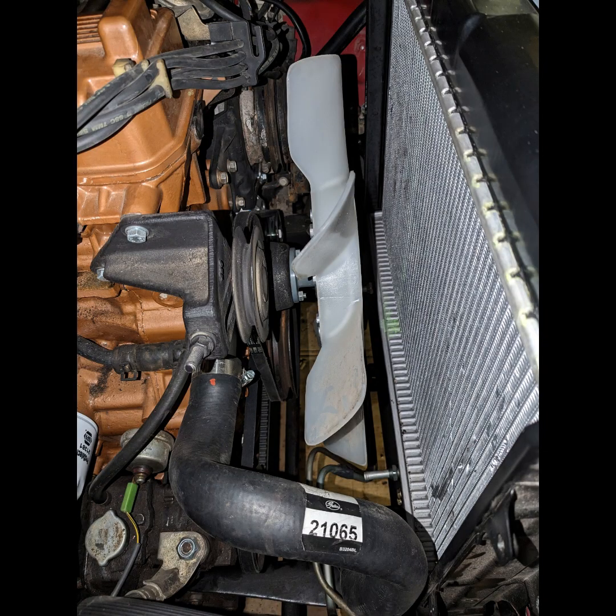So I want to walk you through a few things before you get started. First of all, that body's going up, but the engine's staying in the same place. So your bottom half of your radiator shroud will need to be removed. If you're somewhere cold, maybe you can get away with it for the year. But if you're somewhere in the South, Phoenix, SoCal, Texas, you're going to want to move the radiator, the fan shroud, get that figured out so that you're still keeping that cool air coming through properly.